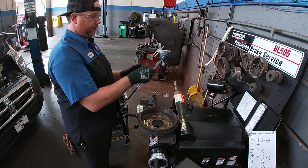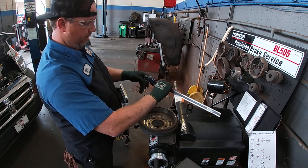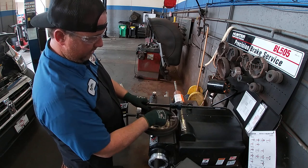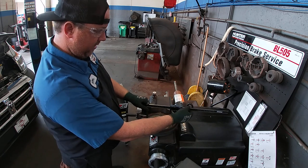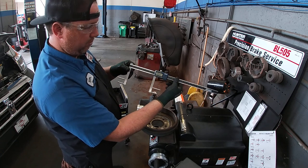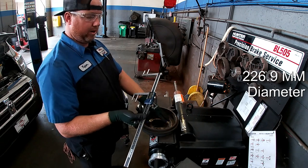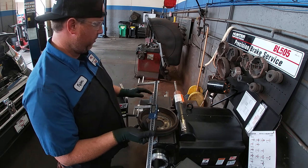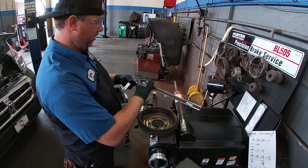You will need a special micrometer to do this. With our micrometer zeroed out, we go right across the top using the leveling bars that drop on top of the drum itself, then measure straight across. I have a measurement of 126.9 millimeters, which is under our maximum, so this drum is cuttable. We'll try to stay within a millimeter range when we cut material off.